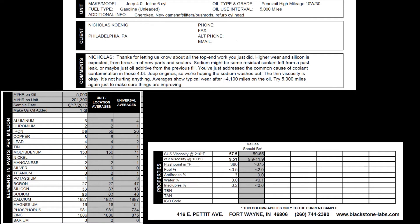In the comments they pretty much say that due to the break-in procedure of the new parts, my unit averages are going to be higher than normal — that's to be expected. Hopefully the sodium from a potential antifreeze leak from changing the head washes out with consecutive samples. I definitely intend to get another sample in another 5,000 miles. This Jeep is at 200,000 miles, which is pretty average for a Cherokee — the 4.0 — you can find tons of them on Craigslist exceeding 200k.